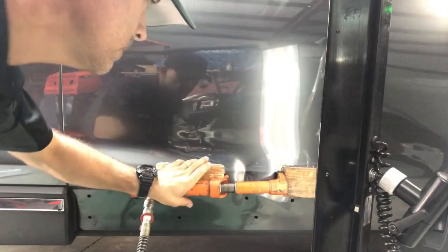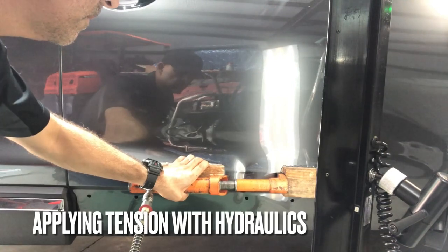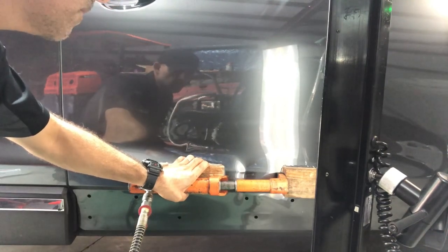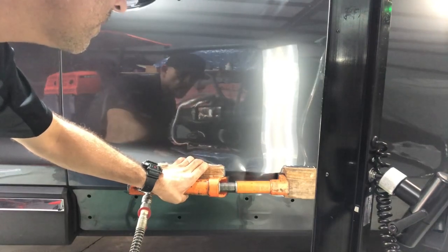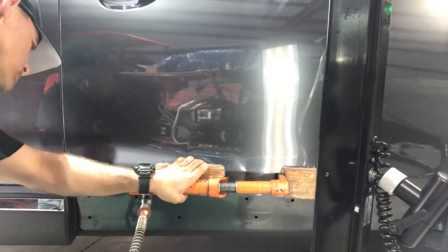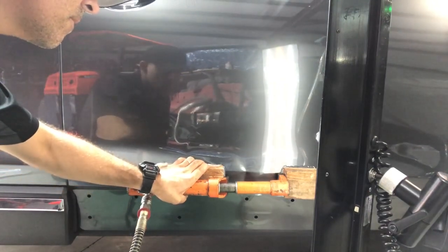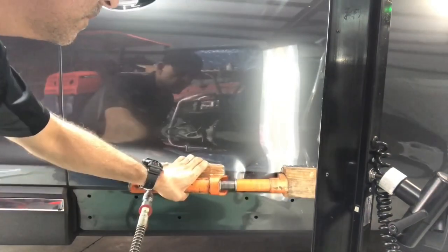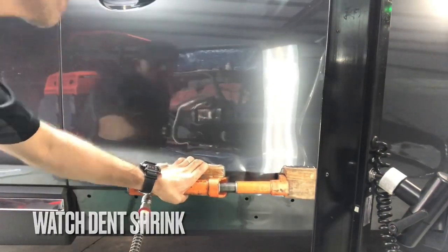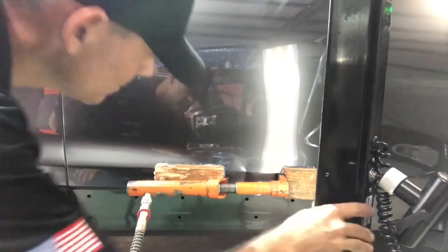One of the biggest factors is that the damage runs right across that body styling line. And you can see here, what we're doing right now is actually applying tension. When we do that, we can actually unfold the damaged metal and take the pressure off of it, which minimizes the dent and speeds up the overall repair time. Pay close attention to the reflections around the dent and the dent kind of shrinking — that's exactly what we want.